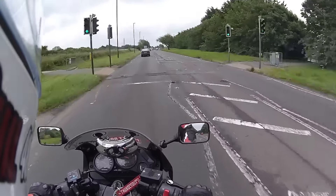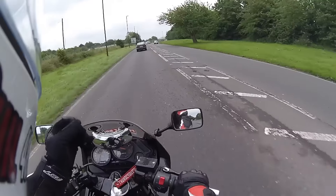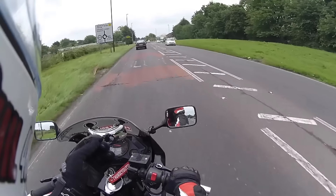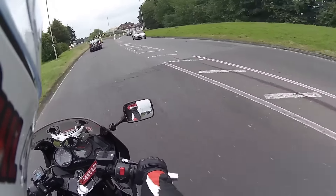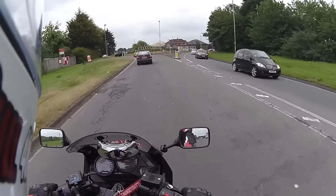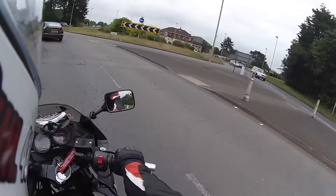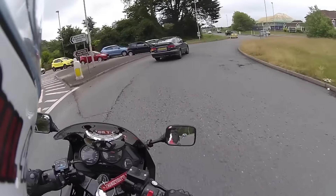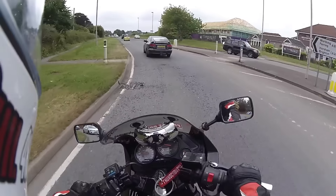It's a little bit overdue, if I'm honest. The chain has pretty much had it — I checked it the other day and it was quite loose. Even after I tightened the slack up with the wheel, there was still a lot of side-to-side movement in it. So yeah, it is a bit knackered. The rear sprocket isn't too bad, but the front sprocket has gone a little bit shark-finned. So it's time to get them done.